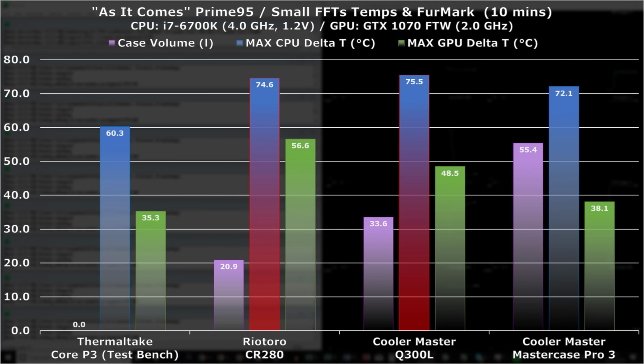Also good to know is that all tests are performed with all fans at full speed, so that's CPU, GPU, and all case fans. So we remove the variable of fan curves from the results. Just to clarify, the As It Comes test system has the only case fan being the included 1000 RPM 120mm fan to the rear, and the max fan graphs has 2 front and 1 rear, as well as 1 top rear 2200 RPM 120mm EK F4120 ER fan.